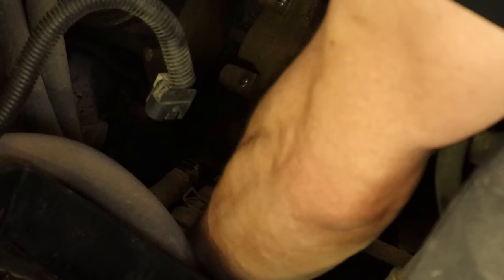Now that the interior work is done, we can rebuild this thing mechanically. We have a wheel hub that's pretty wobbly and I'm pretty sure it's making noise — either way it's got to come apart. And a drive axle that's slinging grease all over the place. So in order to get to those, we have to pull our brake caliper off of here. We're probably going to need new brake pads too because there's quite a ridge outside of that rotor. Push the caliper in and set it up on the control arm. You can see the grease all over everything from the drive axle. Take our bracket off for the caliper.